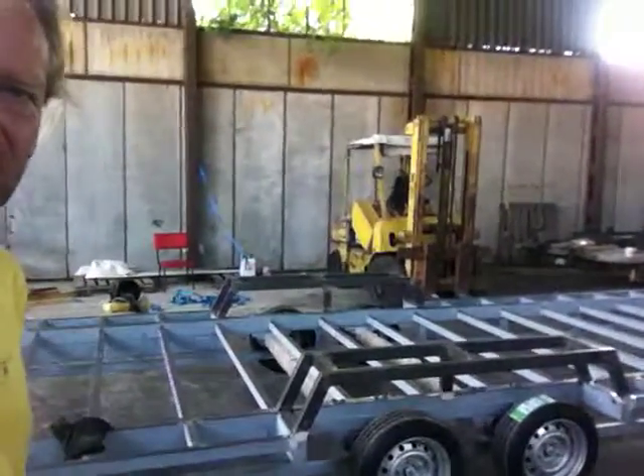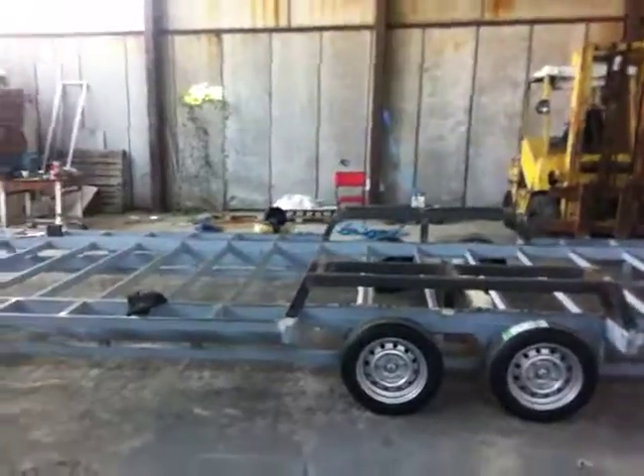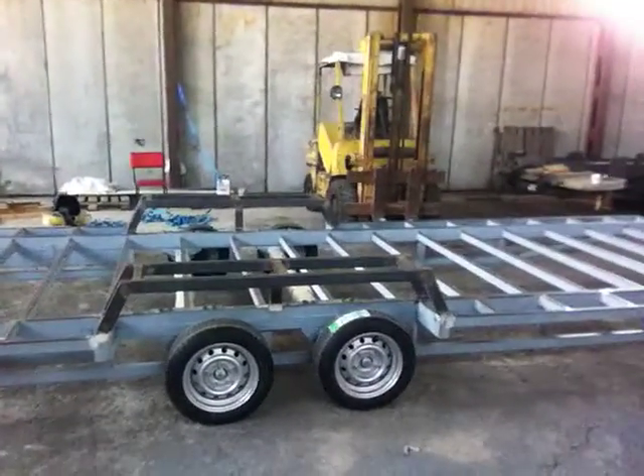Welcome back to the Tiny House Club. So my wheel arches are now welded on, it's coming together nicely — I'm quite happy with the way they've gone. That's also additional ladder bracing over the center of the trailer, but also that's going to be our battery mounting place, which will also help to adjust the nose weight.